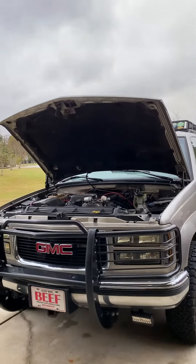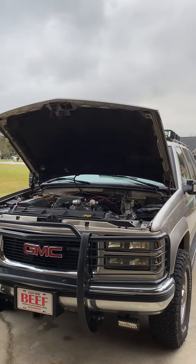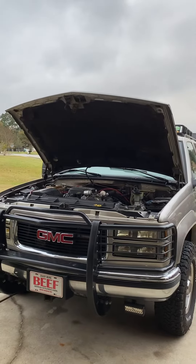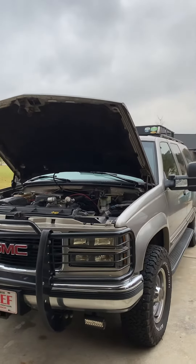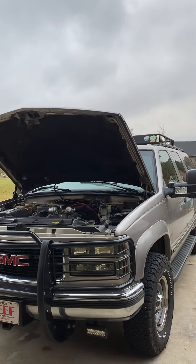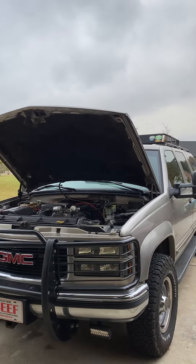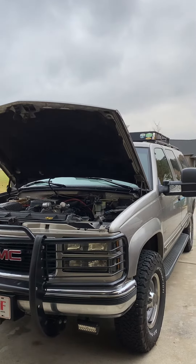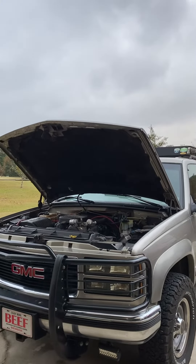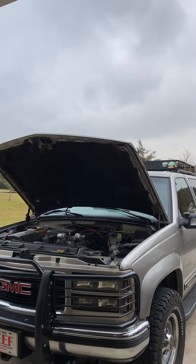and we were driving on a Friday night, of course — it's near Atlanta. When that car quit, I thought I'd never get a tow truck out here. I happened to have a code reader with me. The truck just stopped all of a sudden, and when that happened I tried to restart it — it was cranking real strong, I could smell fuel, but it wouldn't restart. I ran the code reader and it came back with a P0336, I think — a crankshaft position sensor code.